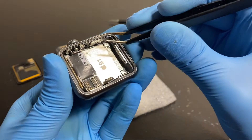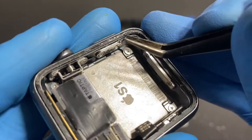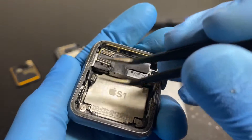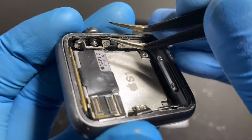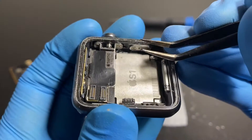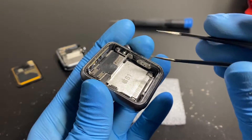First, there is a film of glue still on the force touch sensor. We're going to have to clean it off without damaging the sensor. I'm thinking of using some rubbing alcohol, but my concern is whether it will degrade the rubber. I could scratch it off, but that risks damaging the sensor. I'll do this off camera since it will take a long time.